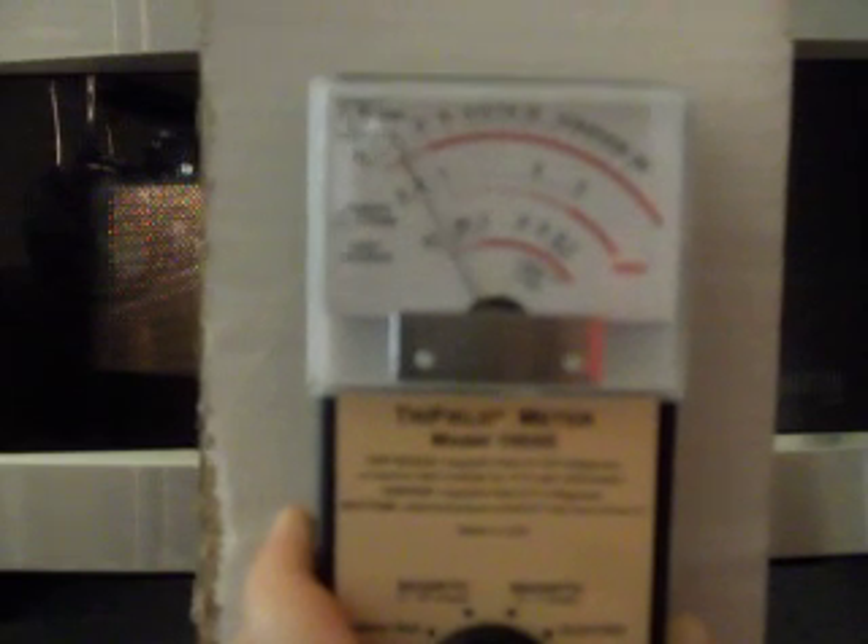And this here is a number of cards I've painted with various paints — there are six of them. We're going to put these in front of the meter and see what happens. As you can see our meter is definitely picking up the microwaves. When it comes to emissions from microwave ovens, paint doesn't really work very well. Although you can get certain paints that are certified to block this radiation — they are generally carbon-based paints.